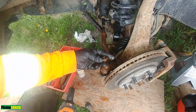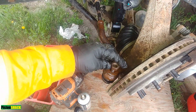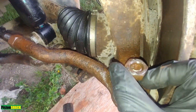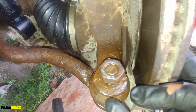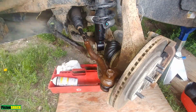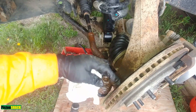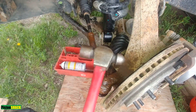It got stuck but it's not a big deal. I'm putting the nut back on — I don't want to damage any parts. If you have to replace the inner tie rod, you need to save the outer. Just screw the nut back and turn it counterclockwise a little bit to make sure you won't damage the threads, then tap it with a hammer a few times. Even though we're not reusing this tie rod, it's always better to remove everything without damaging anything.